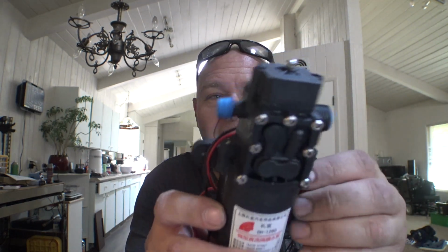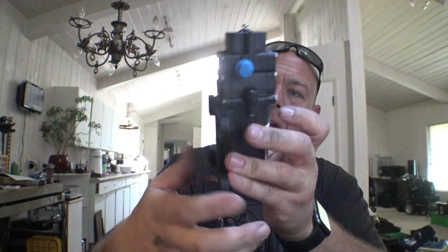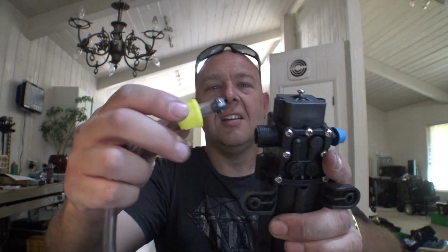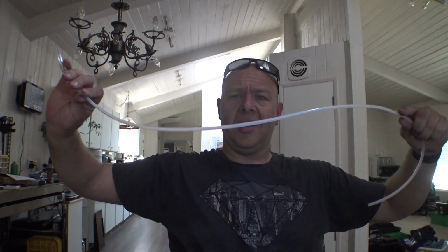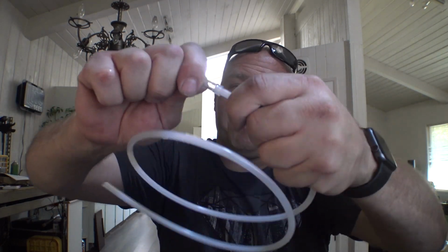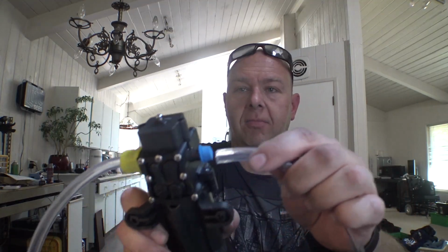But anyways, we've got some tubing and stuff here. And, oh, look at this. A cute little pump. Nice. So this thing just hooks up to a 12-volt battery or jump pack or whatever. So this goes on here and then clamps down. This will go into our 5-gallon buckets. Then we've got a thinner hose here that is somewhat rigid. Now this isn't long enough to make it down the dipstick, so I'm going to put an extension on here and then it just slips on here. Cool. Well, I'm gonna go get some 5-gallon buckets ready and we are going to pull some engine oil out of this thing.